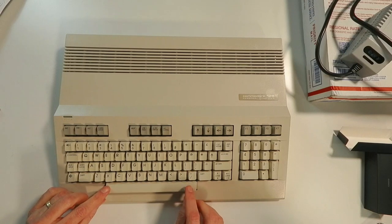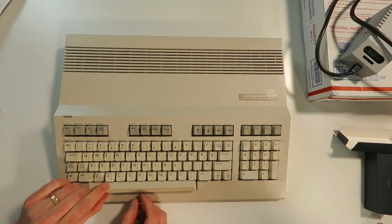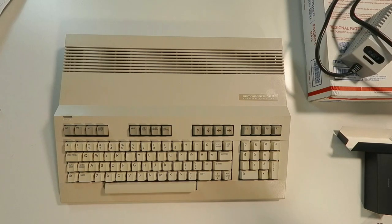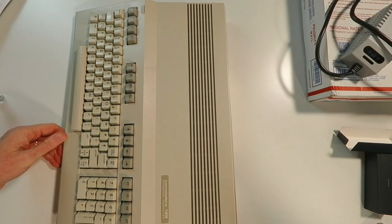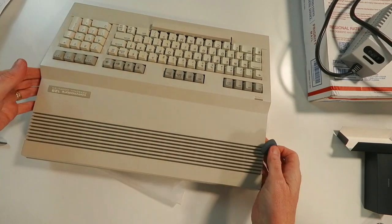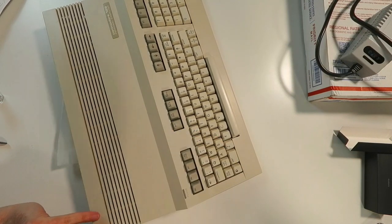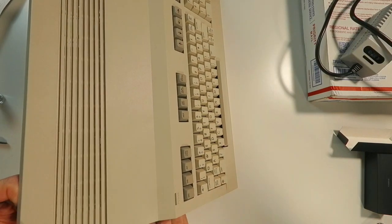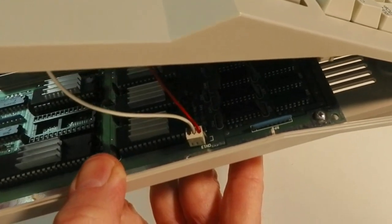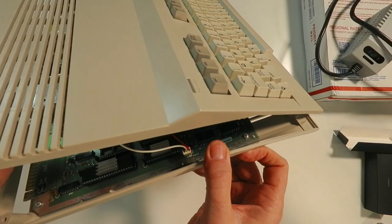Got an issue with our keyboard here — I'm going to need to fix that while I'm in there too. A key came loose, and here is the spring right here — spring issues. This probably would be a good point to use a guitar pick. There we go, it just popped right off. I see exactly what the problem is with the LED connector — that is not seated properly, see that one pin right there? It's missing a pin, so we just need to slide all that over one. I have that back on the way it should be.